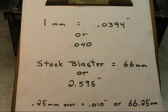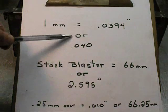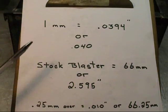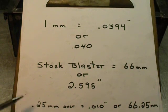The first thing we have to do is a little bit of math, unfortunately. One thing that a lot of people ask me — they have a hard time distinguishing piston sizes. So what I'm going to try and do is explain this. One millimeter equals 39 thousandths, or you can round it off to 40. That means every 10 thousandths equals one size over, or .25 over a stock bore, or whatever the existing bore is.